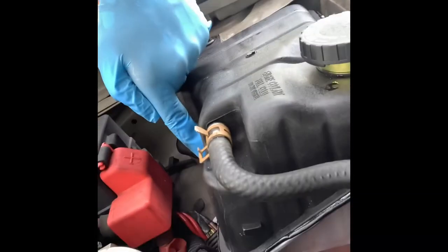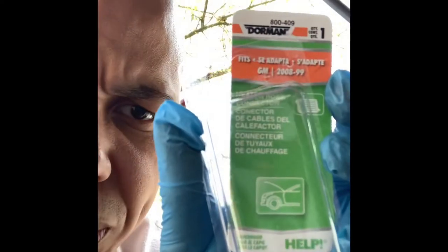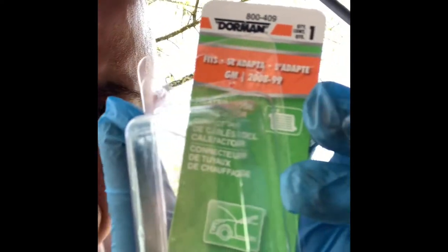I finished — the reservoir's in. It was easy to do. It actually has two nuts you got to take off, one on each side, and this back one. I emptied my fluid out and put it back in, so we're good to go. The one thing to be careful about — this is an 04, so it's a 16 or 17-year-old car, and some of these housings and tubes are just messed up. I was able to find the exact housing at AutoZone for $8 — part number 800-409 — and it was an exact OE fit. Wish you guys good luck, enjoy your day. Peace, thank you for watching.